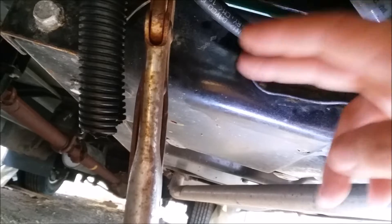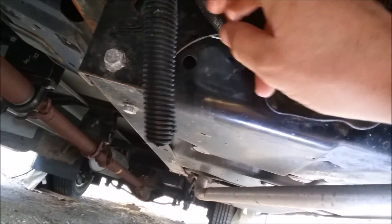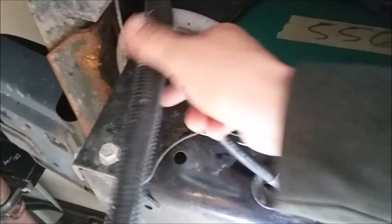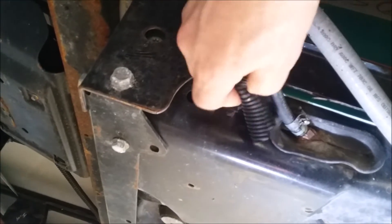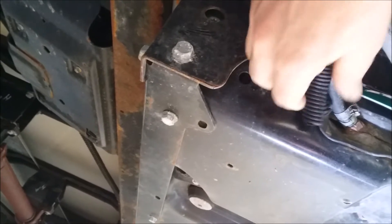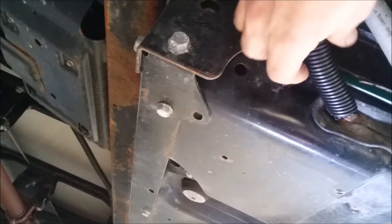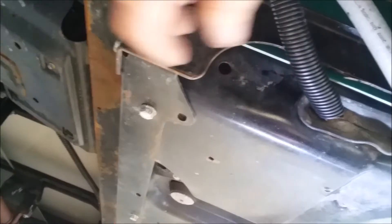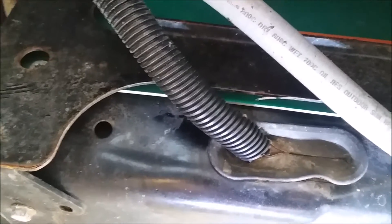You can see here I've reattached the coach gas line and the clamp, and I'm going to remove the vice grips. I put two pieces of wood there just so I don't pinch it too badly. I'll work that out with my finger to make it round again, put my loom back over that, and that's it — the coach fuel line is reattached to the generator.